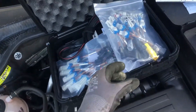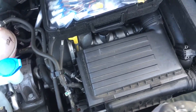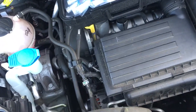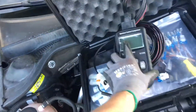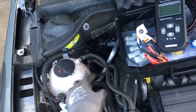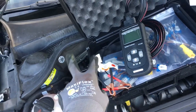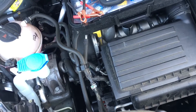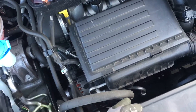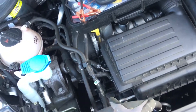This was a real-world scenario where, because I didn't have the tool with me, I could not prove whether the signal was not getting to the valve or whether the valve was sticking. If I had hooked up my tool and commanded it to increase the duty cycle, I would have seen the low side go down and the high side go up. If I had connected my tool to that valve connector and commanded increased displacement and the gauges didn't move, then I'd know it was the valve. Or you can back-probe the actual wire at the connector and read the duty cycle signal coming from the car.